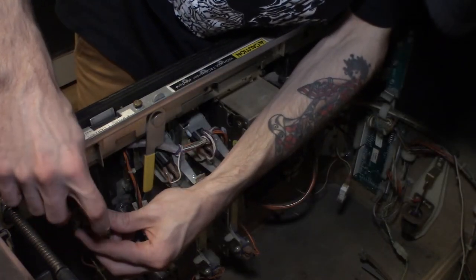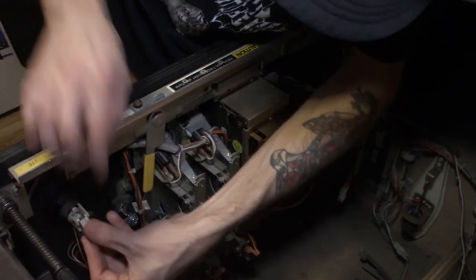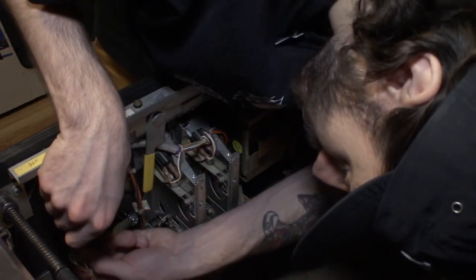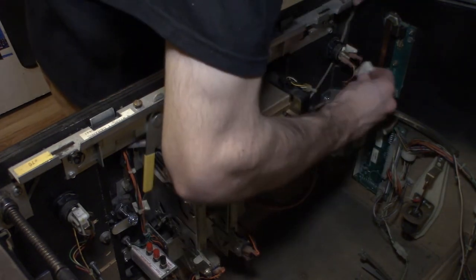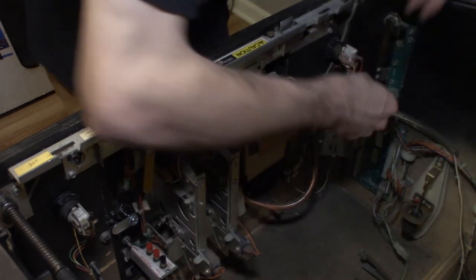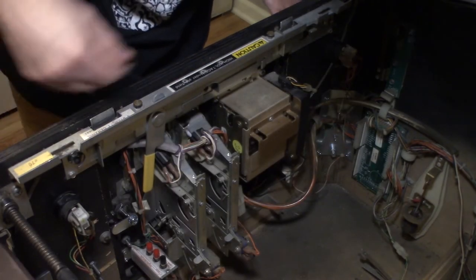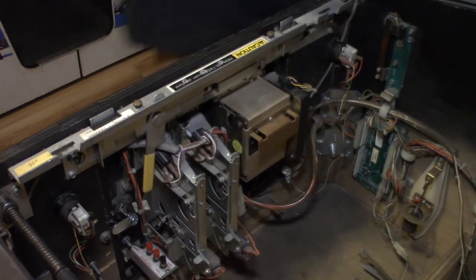Again, there's two holes here, top hole and a bottom hole. Basically, switch goes like this, and then it rocks down in. You pull this plastic back, and it locks in, and that's it. That's us hitting the switch. Make sure you didn't screw up any wires when you did it, and then it's going to rock the exact same way on this side. So put it vertically, and then bend it down into place. You'll hear the snap because it went in the hole, and there's both of them, no wires broken or anything. And we got LEDs here and on our start and extra ball buttons. So those are done.